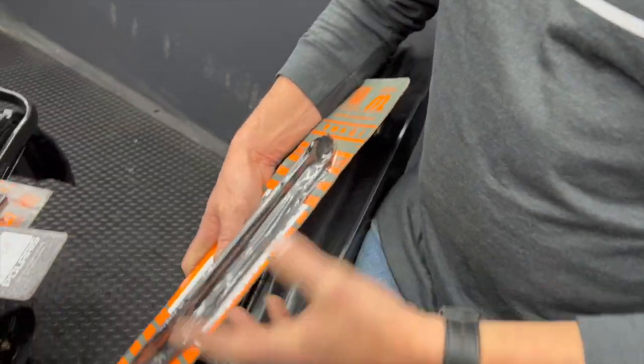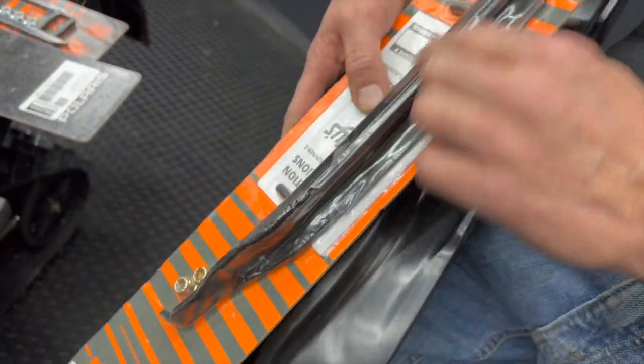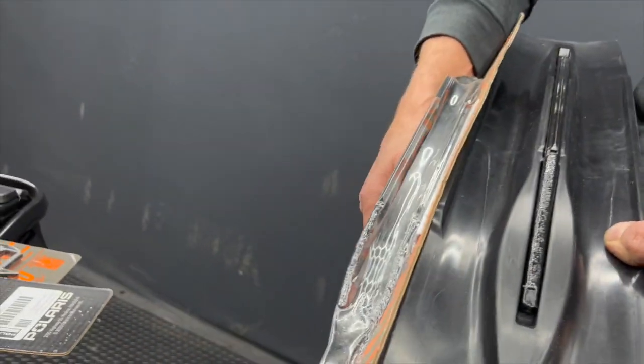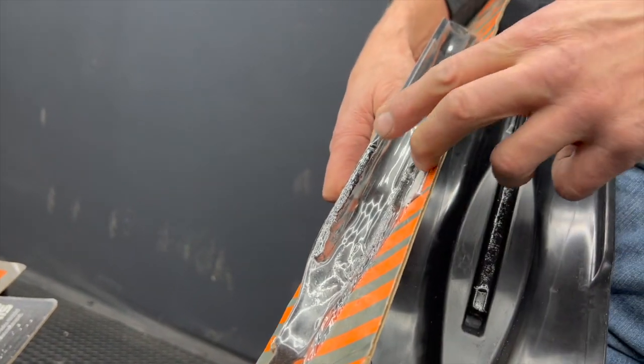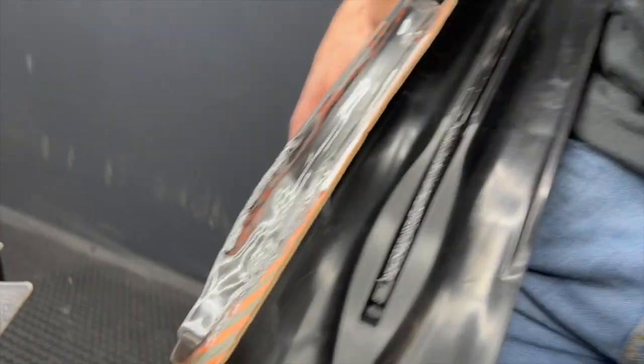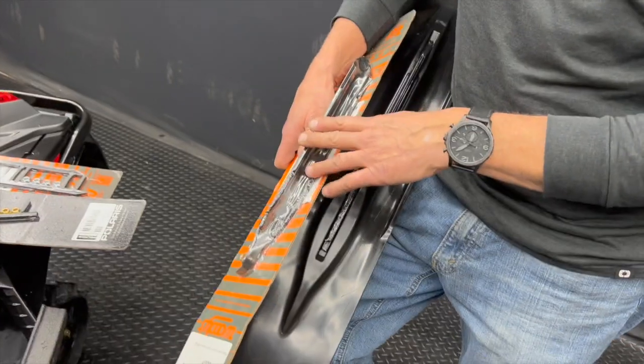When you're falling into those grooves your handlebars are going all over the place and you're trying to correct but it doesn't stop. What Woody's did is they made what they call a Slim Jim and a Dually. This is a Slim Jim because the bars are literally thinner. A Dually has very fat bars. With these on there you're making your own new groove, so no matter what's on the ground you're not going to fall into those ruts — it takes care of almost a hundred percent of darting.